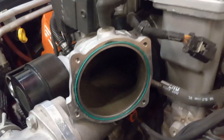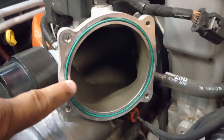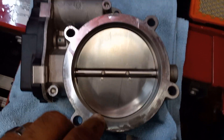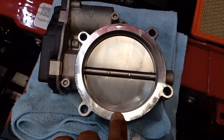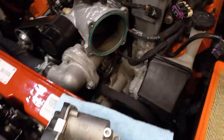While I was here I did mic the snout — it is exactly 95 millimeters, and I mean it is a tight 95, not like 95 and a little bit. The throttle body itself is also 95, but again it is a very tight 95 — almost like a hard 95, you could call it like 94.8 for both of them.